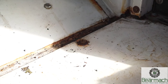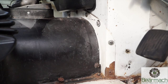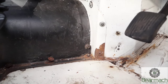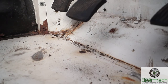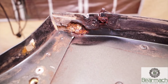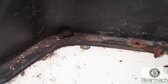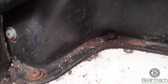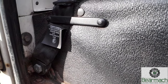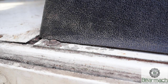These are nut and bolts — this part, if damaged or corroded, can be replaced. The floor has to come out, and unfortunately the worst bolts on the Land Rover are on the floor pans, whereas the screws that hold the transmission tunnel in, as you can see here, are fairly okay for undoing. You need to remove the transmission tunnel to be able to get your seat box out. Floor pan bolts you may possibly have to drill or grind the heads off. There is an adhesive seal on the edge of the seat box between the two parts. With the door open you will see M6 bolts, and you'll also have your seat belt bracket here, which is bolted through nut and bolt — unfortunately these suffer badly from corrosion, as you can see this here has fallen to bits.